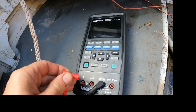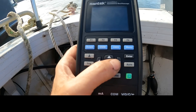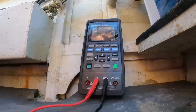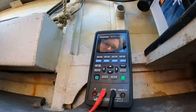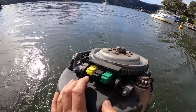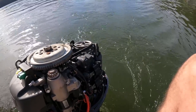We're in voltage check, so I'm going to swap over to milliamps to start with, then change the mode on the multimeter. We've got a 28 milliamp draw all the time. You can see here on the flywheel cover this yellow fuse labelled 'rectifier regulator' — when we first went to start the engine after fixing it, this fuse was blown. It's not blown now, but it makes me think it blew because of an issue. So we're starting to see a bit of a pattern of clues and symptoms.